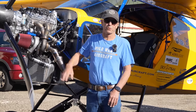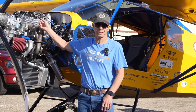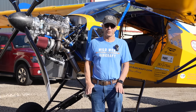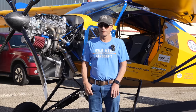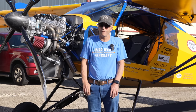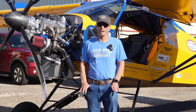This engine has been built by Hyper Sports. What we wanted was to turn the power up pretty much, and the stock engine will go pretty high especially with a bigger turbo and injectors, but when we start getting up towards 400 horsepower the valve train can be kind of on the edge of having a problem. So it's like, let's build a head for it — they do a lot of these engines for snowmobiles so they're very familiar with them. We thought, let's build a head we're not nervous about the valve train, and then we thought, well if we're going to do that let's just do the whole thing.